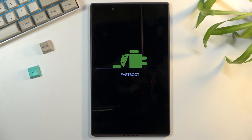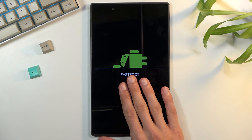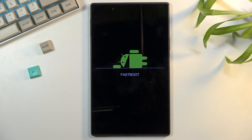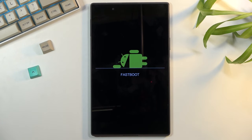Now I'll add some additional info. Once the device turns off, which is indicated by the vibration, wait a couple seconds. When you start holding immediately after it turns off — those two keys — it for some reason won't accept them, so the tablet thinks that you're not pressing anything and thus it won't boot into it.